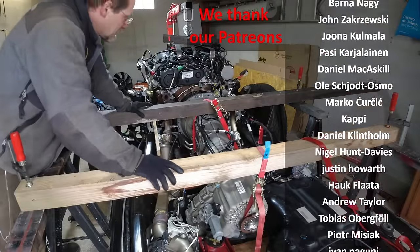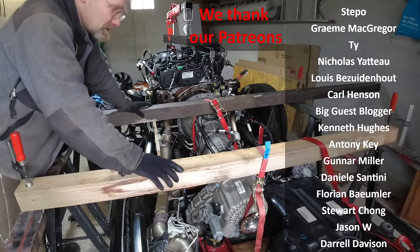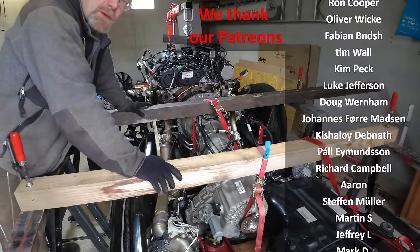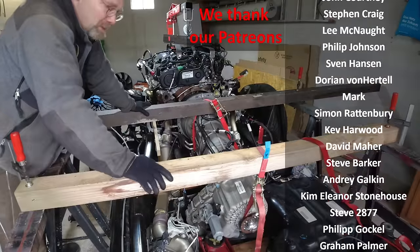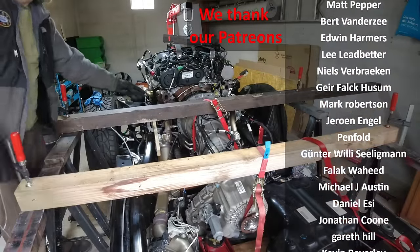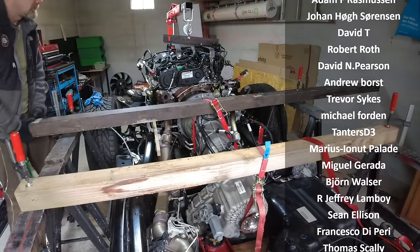I know things changed a little bit and I screwed up. But as a YouTuber, you know, I can hide all this in the video and just continue a few hours later. I should have taken the oil pan off in order to get that engine out with the torque converter on. So I had to disconnect the transmission now and built me a little tiny support for it so that I can balance that transmission at the same height as the engine while I lift it.